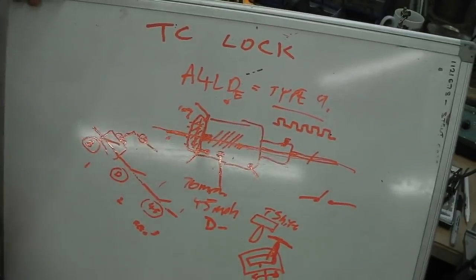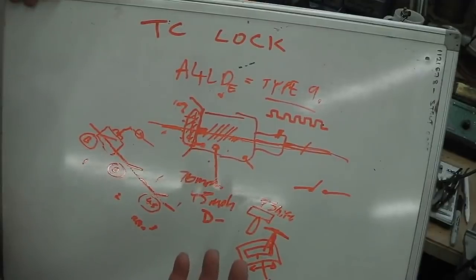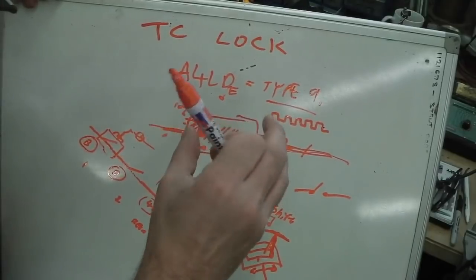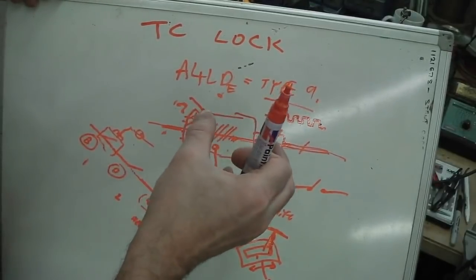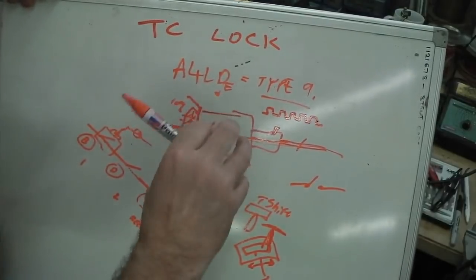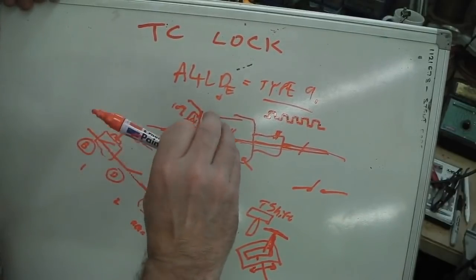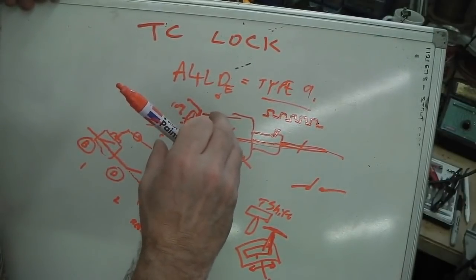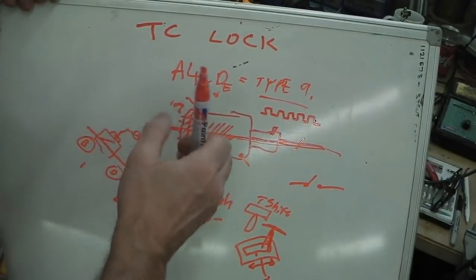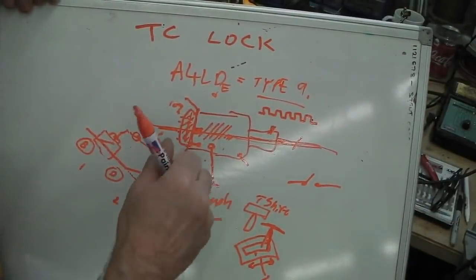Your wall thermostat at home has got hysteresis. Think about it, with the old school thermostat, before digital thermostats, when you turn that stat on the wall of your house, you hear it click. But then as you turn it back, it takes a little longer to click back off, or whichever way it was. That's the range, or the hysteresis, of operation. I turn it, it clicks. But when I turn it right back to the point where it just clicked, it doesn't until you come a little bit further back. So you've got that operating zone, and that's what we've got to build into this speed controller: an operating window of where our speed is.